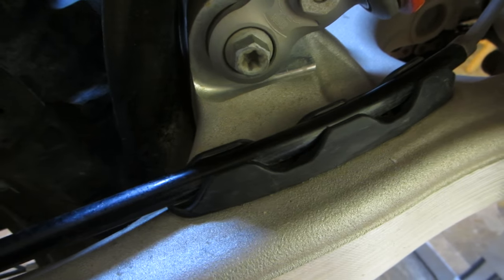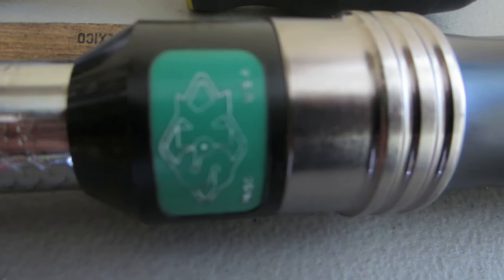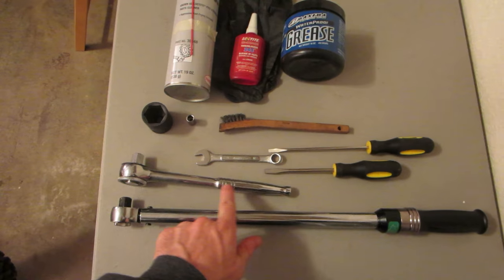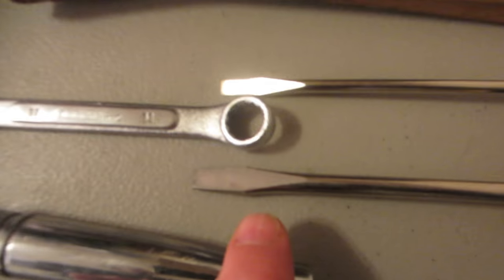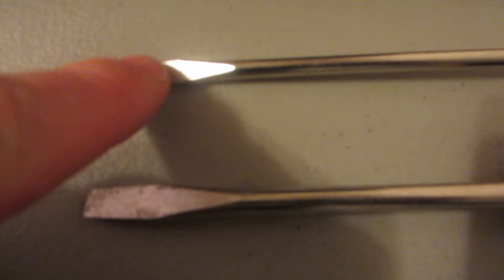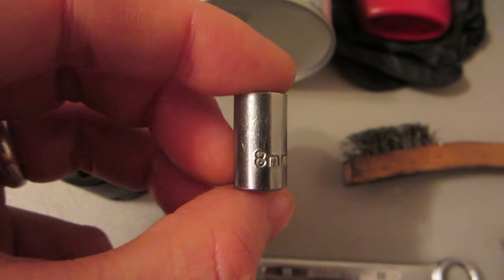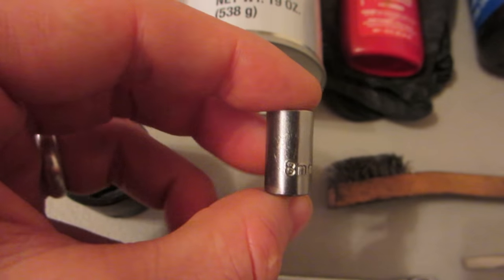Make sure to put the brake line back in. I used a torque wrench — it's in foot pounds, this one is SK, made in USA. Another wrench for breaking the back tire free. You need two flat head screwdrivers mainly for getting those brake pad clips back in if you need to. You need an 11mm wrench for undoing the brake, a 27mm for getting the back tire off, and I use a little 8mm for jamming in the chain when I'm putting the tire back on to make sure it's all tight.